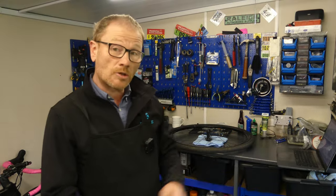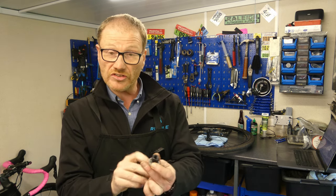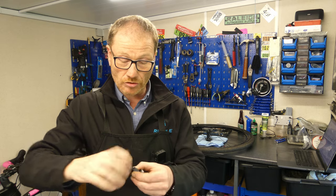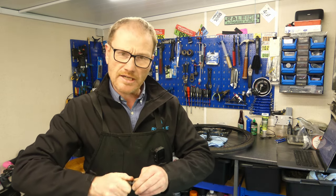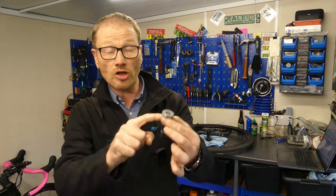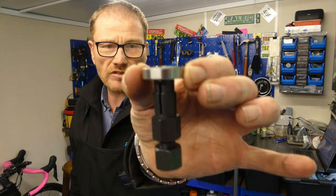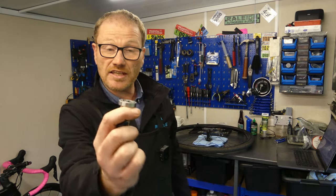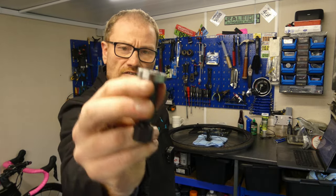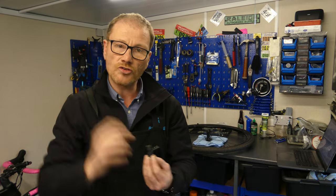Okay, so how does the blind puller work? What you have is something called a collet, and this sits inside the bearing, and then a pin goes through. You wind the pin in only by hand, you don't need to use a spanner. Then the collet will expand and grab hold of the bearing, as you can see. And it sits perfectly flush on the bearing, so it won't affect the preload tube. So let's insert that in and draw the bearing out.